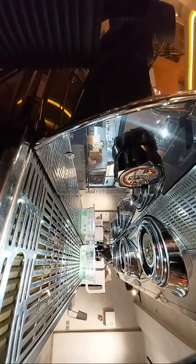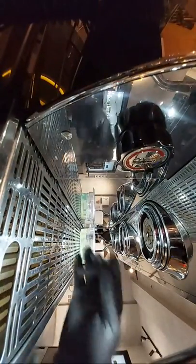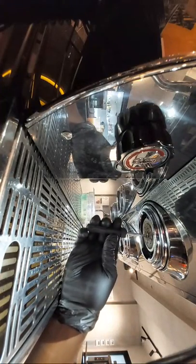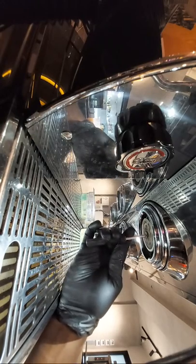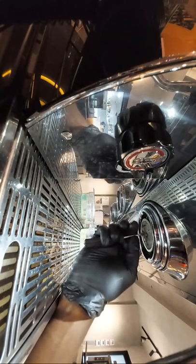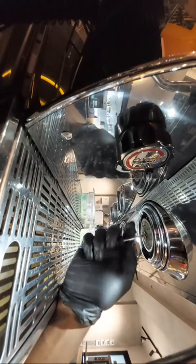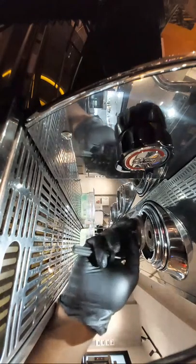I'll need to first disconnect. Okay, there we go. This is the group head — one, two, three. I've already cleaned the third one; I'm going to clean these two. I'll first open up this nail. This nail allows water through — it has a hole where the water passes through to enter the screen head. So just opening it up here.